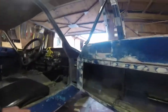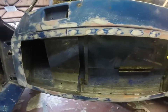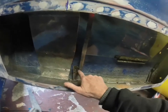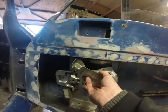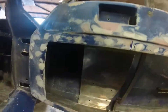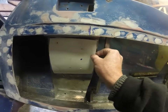I've modified the bracketry. There are four holes I no longer need, but I've altered the bend at the bottom so the foot still sits there but there's now a bend which enables the line of the bracket to follow the line of the window channel — a bit neater. The motor will be mounted three inches below the top line of the fibreglass. I've already made a template for that, so I'll put that on and start drilling some holes.